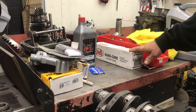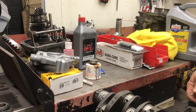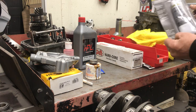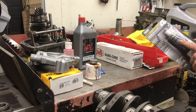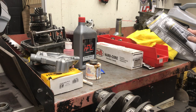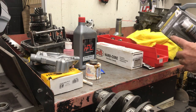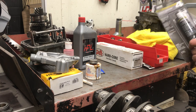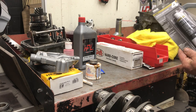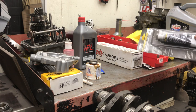The other topic I had a question on was case sealer, and I just hate talking about this because everybody has their favorite. I've been watching YouTube and there's a couple channels that do good tests — one of them is Project Farm. He tested silicone, and Honda Bond was pretty good, and the Mopar sealer was pretty good, but some sealers just weren't good at all. Go check that video out and make your own opinion. Yamabond is what I use on my transmissions and race stuff — it won't leak. You can break the transmission and the side plates won't come loose unless it's really catastrophic. It's not that expensive, about $14 for a tube. The Mopar stuff also looked really good in the test.